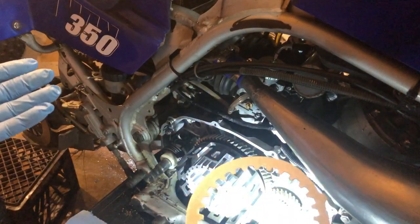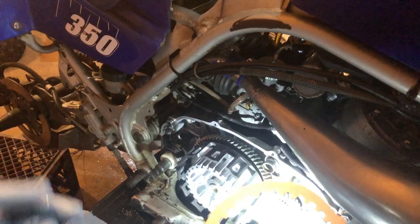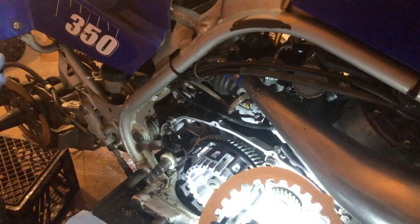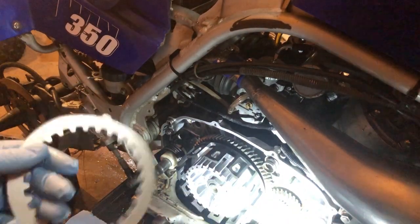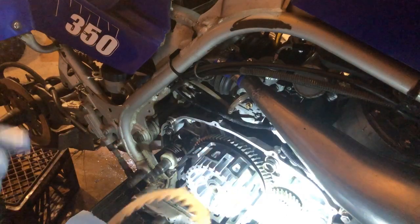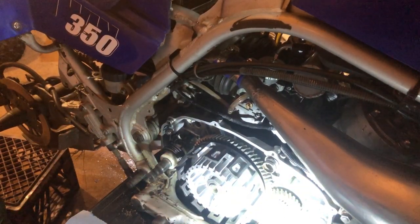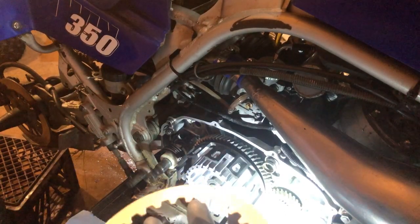In fact, a story: when I was younger, I used to be involved around racing a lot. I used to see guys come in off the track, and they would drain the oil and tear the clutch out real quick, flip it 180 and slap it back in, and it'd be like halfway a new clutch, and go out there and race again. It's just something I saw when I was younger, being around racing a little bit.